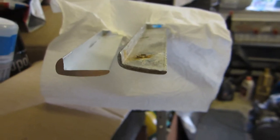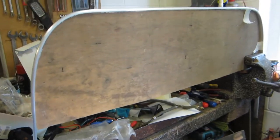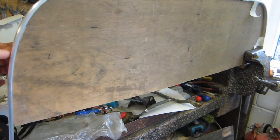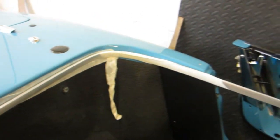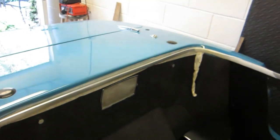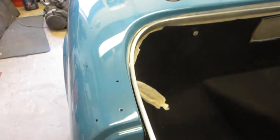Pretty good. The new one is supplied by Woolies in the UK. I've made a start bending it around the template; I'm sure it'll need tightening up a little bit because this is on the outside of the template, so I've got the thickness of the aluminium to take into account. That's worked pretty well. Fortunately the aluminium is quite soft so it can be manipulated. I think the next thing to do is drill some holes and fix it at the back, then work out the side parts from there and cut it to length.